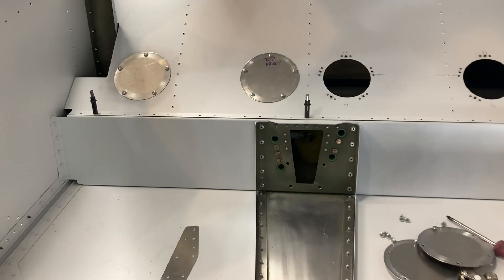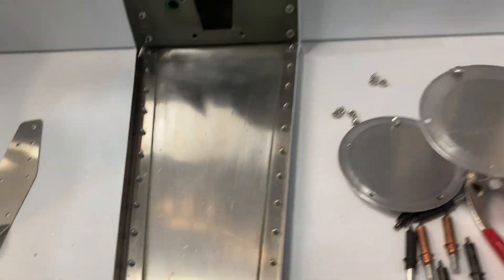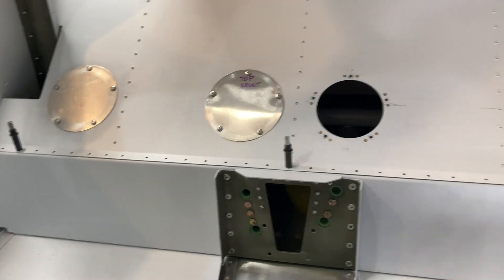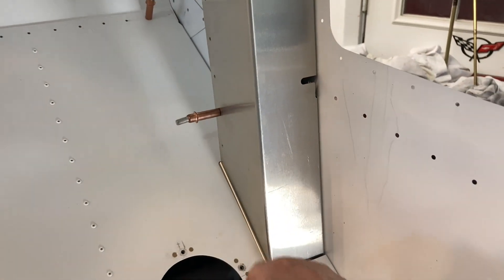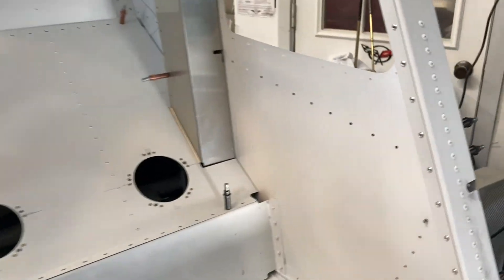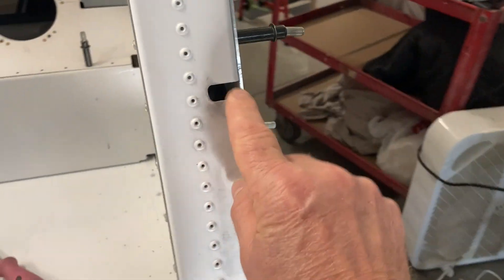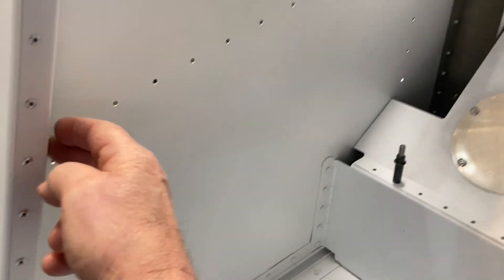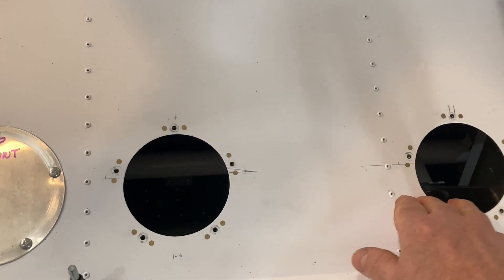I've been working on the idea for these. I like round because it's easy - you cut it out and away you go. I made extras for later in case I need them somewhere else, but I just labeled these one, two, three, four. I did some test runs where I got some wrenches down in there and got this all clecoed in. I put this in temporarily and I'm going to set this on top and do some drilling to get those lined up. I did a test run on the rods - that upper one on, and these had to be rounded out quite a ways; it didn't want to sit on there quite right. The rest of them fit with nice clearance so far, and these work.